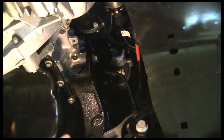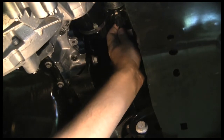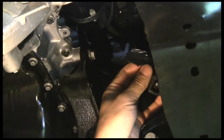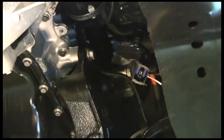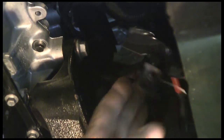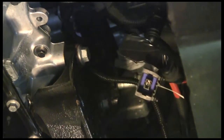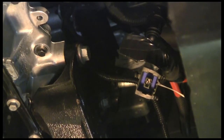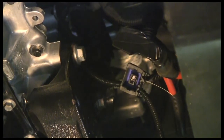Now we've located the starter here and the lead to the starter. We went ahead and prepped these — we've got a plug here and we've also got the connections: a 13-millimeter nut up here. We went ahead and pulled that. The battery's disconnected right now, so we wrapped it up in electrical tape. To open up the doors and check some of the environmental controls, we want to make sure that isn't touching any metal and shorted out. This is another circuit we're going to be using because this is going directly to what will be our auxiliary battery — what was the main battery for the Mini Cooper — and that's going to come into play in our DC circuit. So we're going to label that again: starter, and we should be able to reuse that.